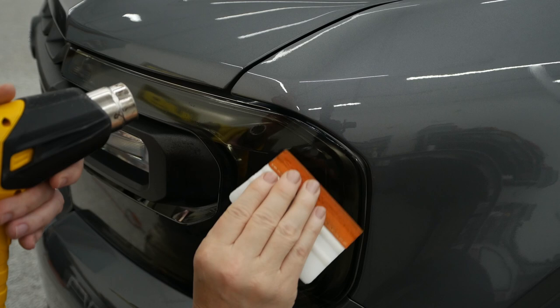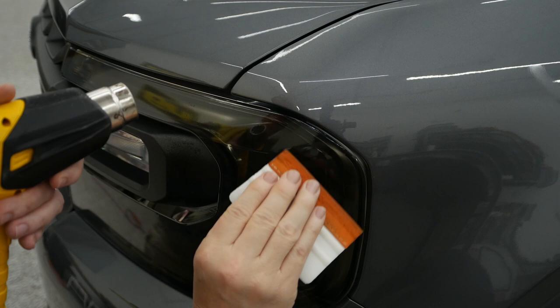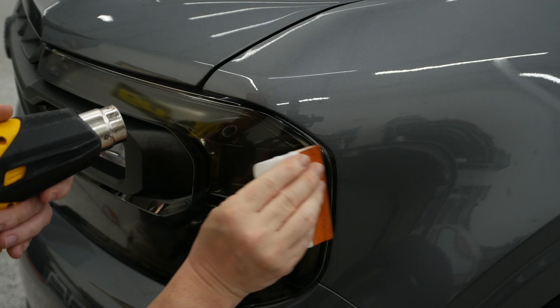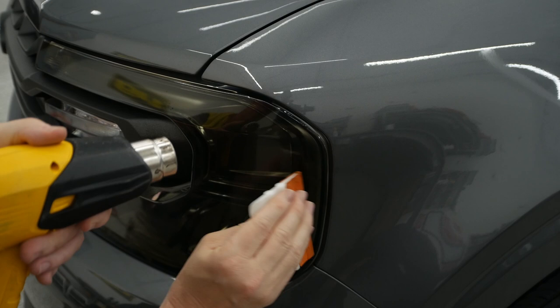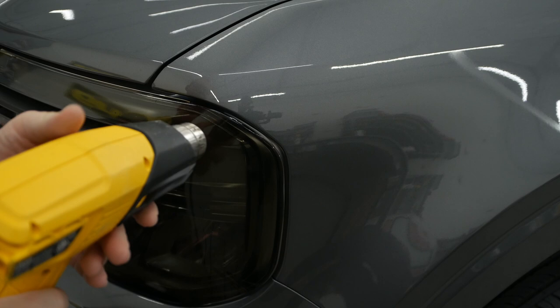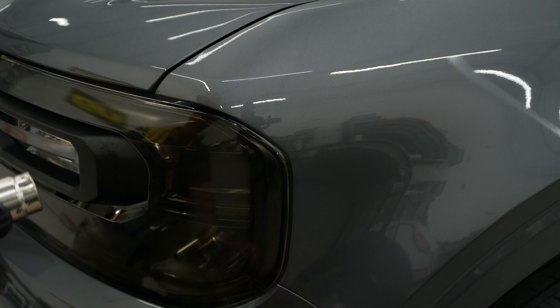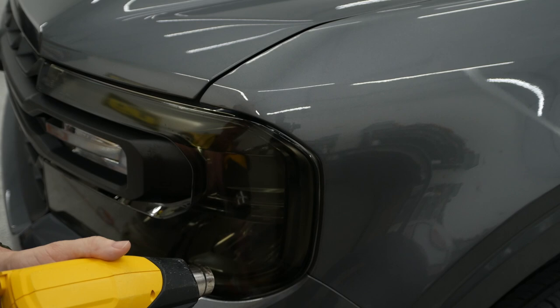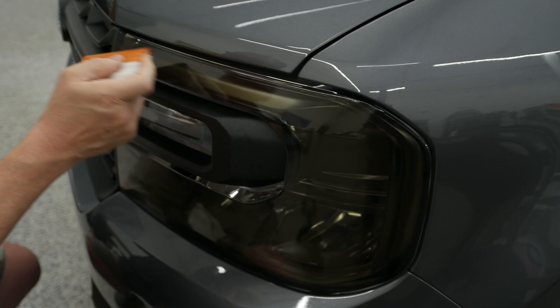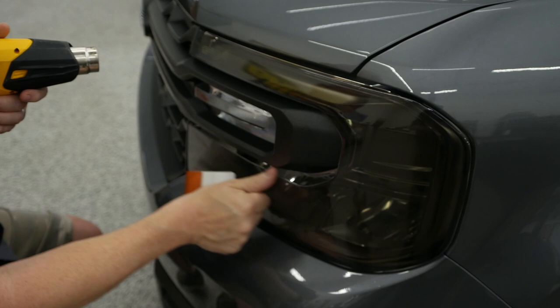You can see we just worked that right out. You want to get a little bit on that edge and wrap around — that's going to anchor it. We didn't want this to be just the face; when you start to get it on that edge, it could be too much or too little, so right along that edge. Once you've got all that face of it out, from here you can really just wait for that water to evaporate, let it get some tack, and then go back and really seal those edges good. Let's go ahead and move along to the rest of those pieces.